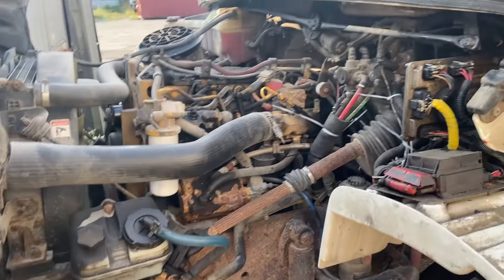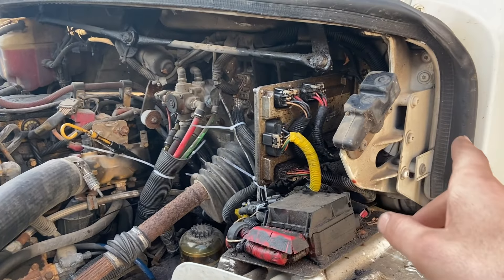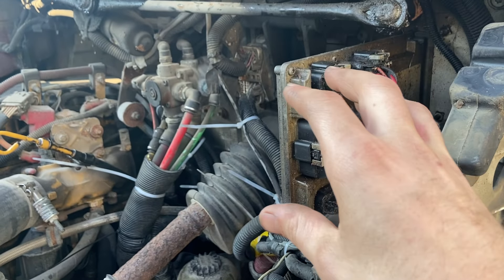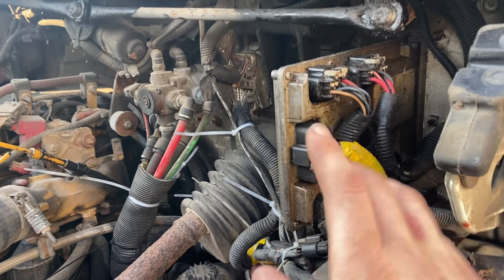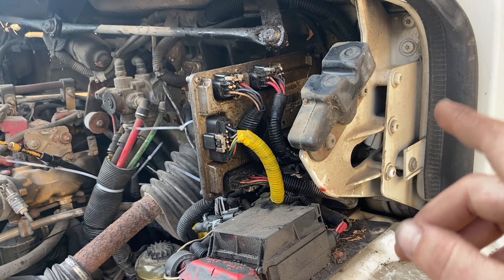You can see - I believe it's that connector right there on the end - and that one has the yellow and green wire, the communication line. Now there's a fail-safe system that's put in place on these trucks in case this module or the other module dies for some reason, or if the communication is severed. This bulkhead module receives all the inputs from switches and sensors and all that stuff - it's like the brain of the whole electrical system. It then sends a communication signal via the CAN network to the chassis control module, and the chassis control module controls all of your light outputs.